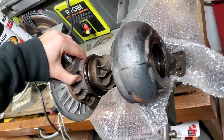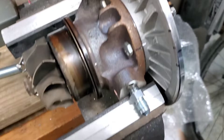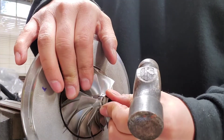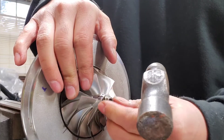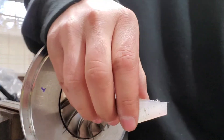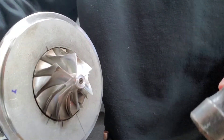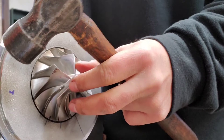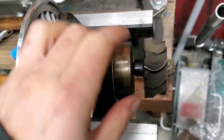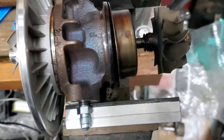Now we have two separate pieces and it really doesn't look chewed up at all. I have rubber jaws — you want to make sure you don't mess up these flats for your feed and drain. Loosen this nut with a right-hand turn, and then while the nut's on, tap the shaft with a rubber hammer. I have a substitute to take the blow so it's not killing it. You can see the piston ring in the back — that's what the oil is leaking out of. This whole shaft area in there is pretty crucial, so don't go banging around.